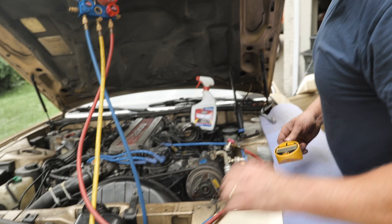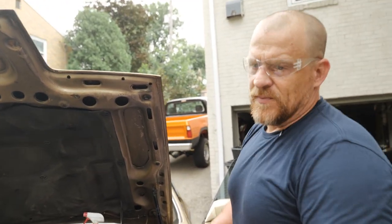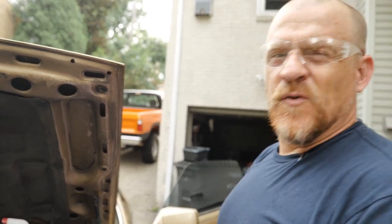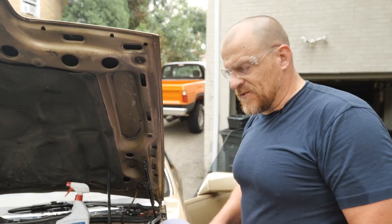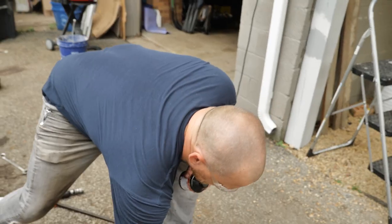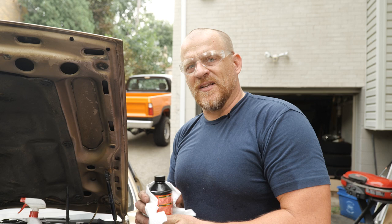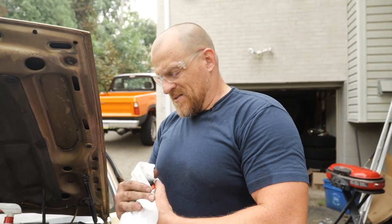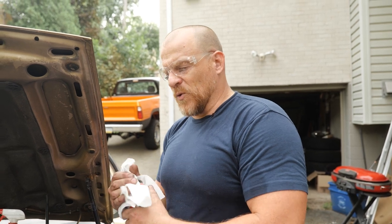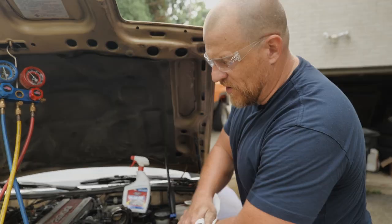We have some time involved, because when I pull it back under a vacuum, I need to evac it for, you know, 30 to 45 minutes. I had some HVAC guys insist on 45 minutes, and I don't think that time is set in stone. I think it matters where you live. If you live in Arizona and you have single digit outside air humidity levels, percentage wise, you don't have to evac it as much as someone does in Florida. I don't think that time is set in stone on what is required for an evac.